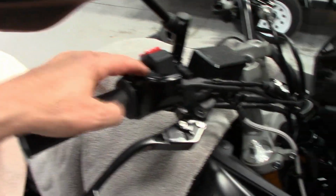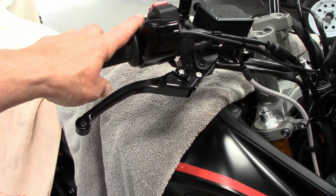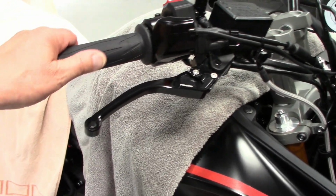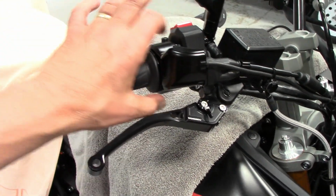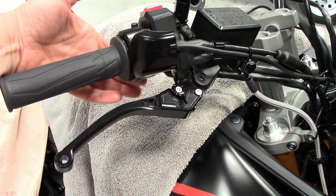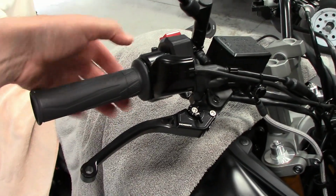Okay guys, I got the throttle side buttoned up. Did a 1/8 inch pilot hole, and then I tried all the number drill bits and they weren't right anyway. So a few thousandths over is a 3/16 common, and that works. This clamps and snugs it anyway. It's just a safety, the pin on the bottom. So 1/8 inch pilot hole, 3/16 hole.